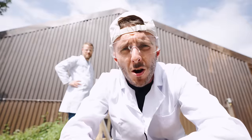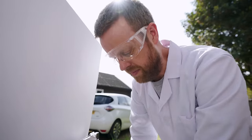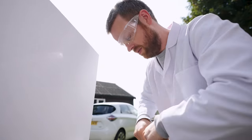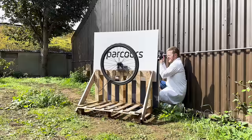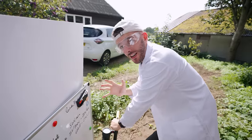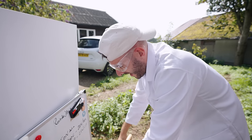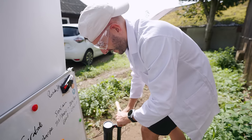First up is the hookless option. This has a maximum pressure limit of 72.5 PSI, which is 5 bar. People are at risk of riding these at higher pressures if they haven't read the instruction manuals of their hookless wheels, which is why there may have been problems in the past. We're going to start pumping it and see how high we can go. 50 PSI. I'm already getting nervous. I'm behind the screen. We are officially 72.5 PSI — probably 73. We are now in the danger zone.